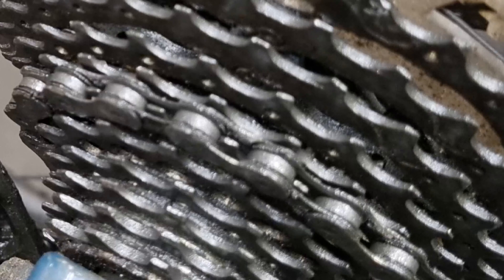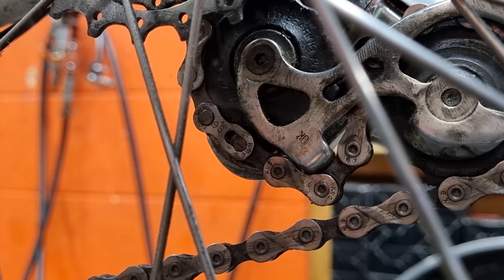The next tip for making your drivetrain last longer: don't get it dirty — and what I mean by that is don't over-oil it. If you over-oil your chain it'll pick up all the dirt off the road, or off-road, and that turns into that black muck you get on a chain, which is like grinding paste and will literally wear it out at twice the rate as if it had no oil on it at all. When people fit a new chain there's one thing I see done wrong all too often: they don't get the chain through the jockey cage properly and run it over the outside tab, which will make your gears jump. I've done it myself recently. And finally, one of the best tips I can give you is not to over-clean your chain.